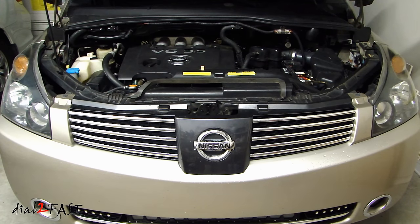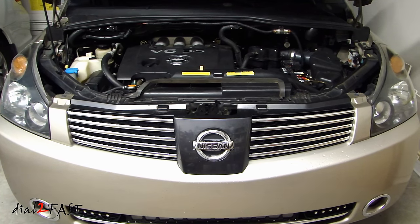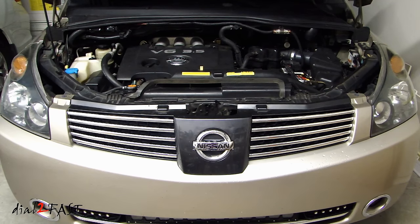Now before ending the video, I do want to mention a couple of things. First, if any of you are watching this because you have a similar cylinder misfire error on your vehicle, I highly recommend that you stop driving it and get it fixed. If you continue to drive with this problem, there can be a lot of unburned fuel that ends up in the catalytic converter and it can damage it. And when you damage your catalytic converter, it can actually clog up and cause damage back into your engine.